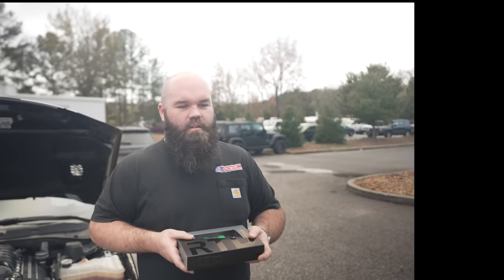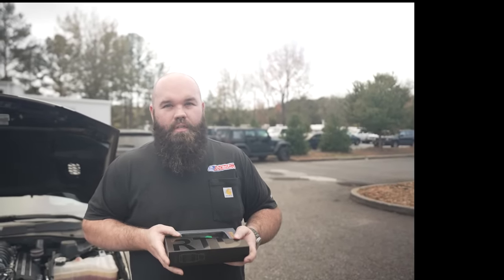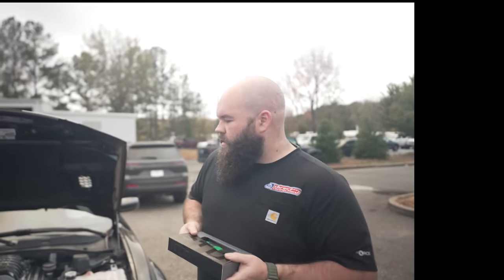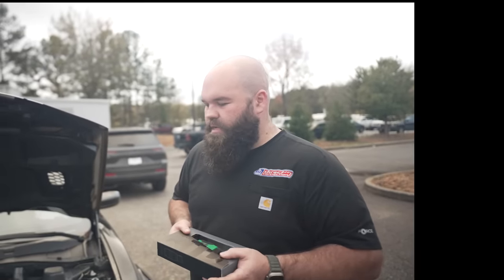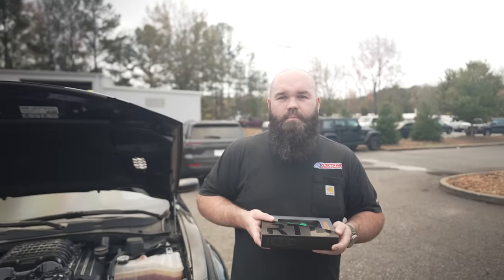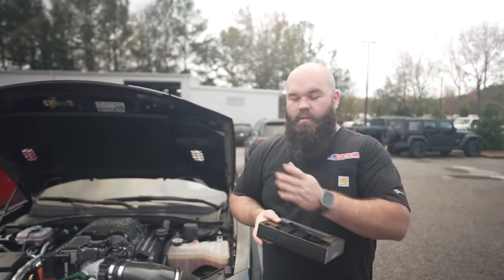The base package runs 93. We're putting 1300 injectors in it — that's what you need for E85 — so we're not double-dipping in labor if you want to go to E85 down the road. The Ghoul package is based around E85, and on 93 you're getting a pretty small pulley. The reason we did the package this way is if you have a Red Eye, you don't necessarily need to do pumps because it already comes dual pump. The price difference between the Demon and the Ghoul is basically the idler pulley plus the 1300 injectors, which are about $800 more compared to the ID 1050s — give or take a thousand bucks over the Demon package.